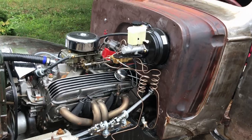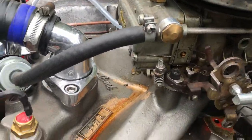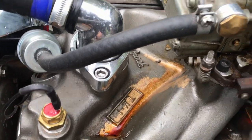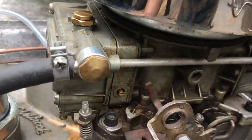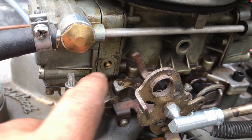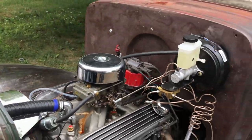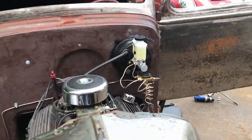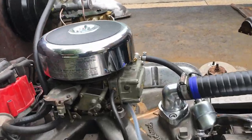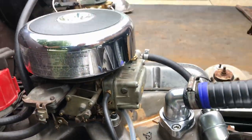Right, while I'm waiting on all your fantastic suggestions, let's try and fix this fuel leak. Seems to be turning red. Maybe it's bleeding. Anyway, I'm pretty sure the leaks are coming from these little mixture screw gaskets. Now, I looked them up. I could only seem to find a set of the actual bleeder valves with the gaskets for like $25, and I'm not paying that for two gaskets.